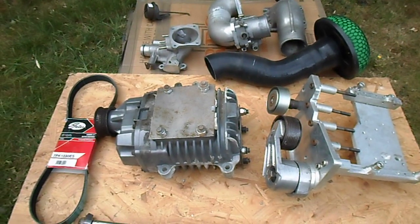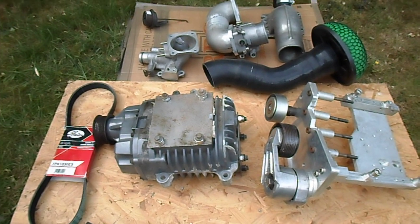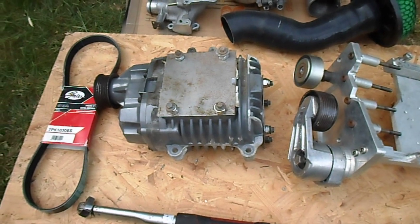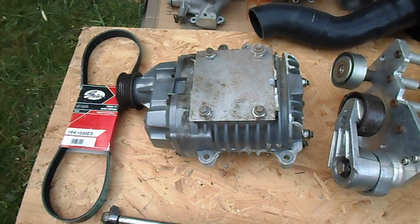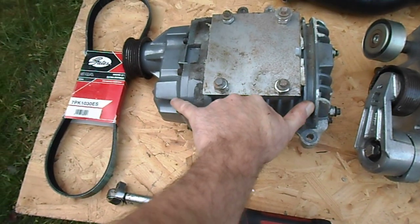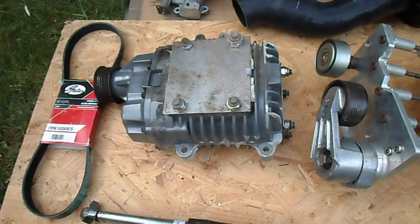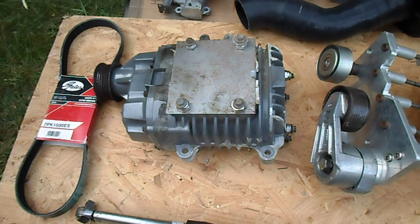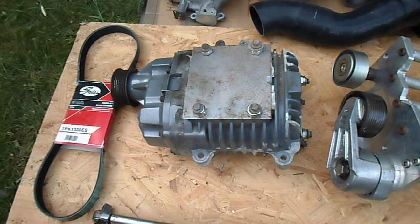This is my setup for my supercharged Toyota 5M GE engine - 12 valve straight six from the Celica Supra. I used a Jaguar M90 supercharger from the XJR6, which is a four litre straight six engine from about mid-90s. It's a short snout, so it's quite a short supercharger - that's my hand for reference - but it's quite a big supercharger. It's bigger than the M62 and a little bit smaller than the M112, but it's a three-lobe rotor and it's quite efficient. It's going to run about 10 psi.